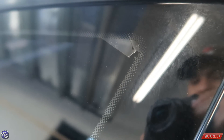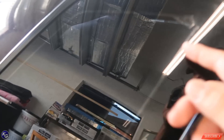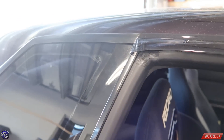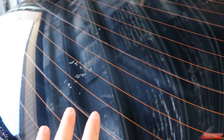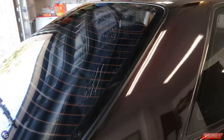This will protect the interior of this beautiful Godzilla vintage R32 GTR a lot more than what it has now. I already started peeling it here, but I'm going to need some steam or heat to help get the rest of the tint off — if you peel it with no heat, the adhesive will lift away from the tint itself. There are more problems on the back — whoever tinted this car tinted over all these specs. The rear has come off, which is another issue he complained about.